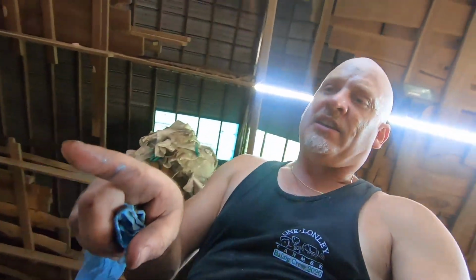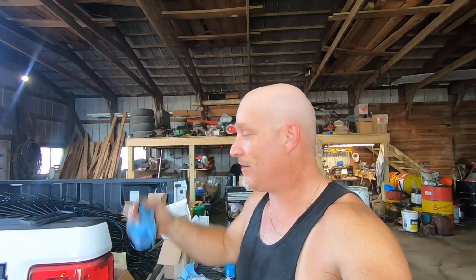It is in this thing. It is a black looking grease, as you can see there. Use it sparingly, but it is specifically designed for heavy duty couplers, meaning drive lines, and that coupler right there. It has an NLGI rating of 1, which is like a viscosity of 1,000 if I've got it right. I think I've got it right. NLGI 1. It is not wheel bearing grease, it is heavy duty coupler grease.